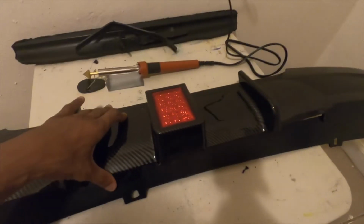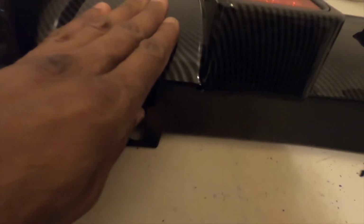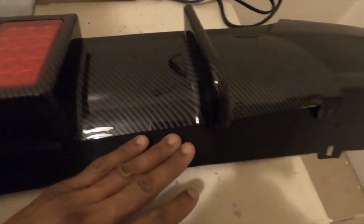I don't got nothing to clamp it down to hold it. So in this part here, there's a little hole. I'm gonna put some plastic in there to hold, heat that up and hold it there. And then just slowly go around like how you do in regular welding and just hold these spots. Hold this corner, hold this corner, hold this. You know, little taps. And then once I think it's holding, then I can slowly go around and put more around this